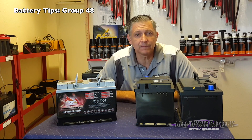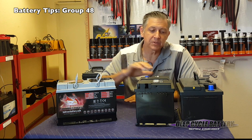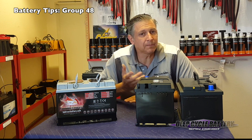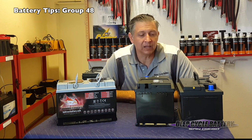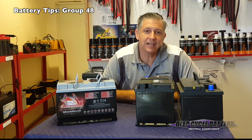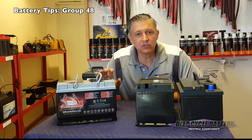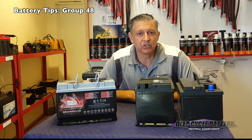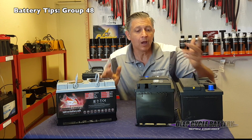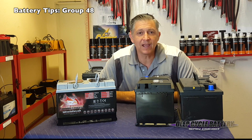Full Throttle has a four-year free replacement, which is pretty unheard of right now on the battery market. So this is our group size 48 series video — I hope this helps you. It all depends on your vehicle and what you're doing with it. A lot of times people just go for the cheap end. One more topic: cold climates. Here in San Diego we don't get severe cold weather, but other parts of the United States do. AGM batteries do better in cold-to-zero-degree temperature climates than the typical water battery. Hope that helps you. We're going to continue this series, move on to the six volt, and we're going to talk about lithium. That's my tip for the day.